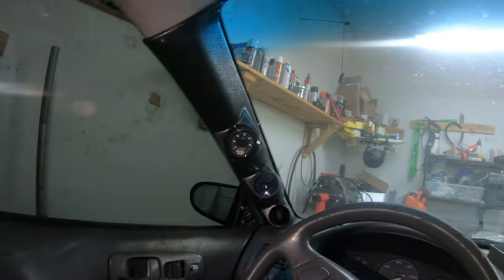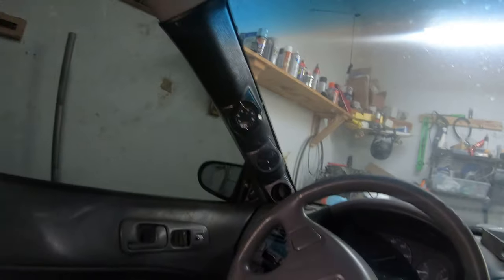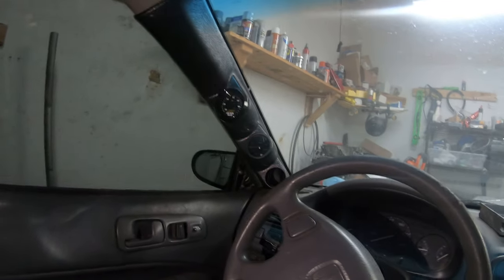So we have this ECU down here and we've got my wideband up there. The next step is to wire up the wideband to the ECU. Currently the ECU is not reading from the secondary O2 sensor because there is none — my exhaust cuts out right after the turbo. So I'm going to wire my AEM wideband O2 sensor to port D14.